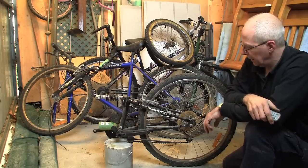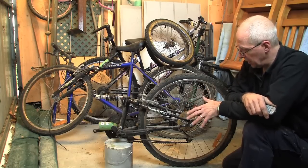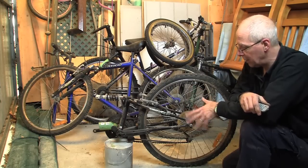The first step will be to cut the parts off the donor bikes. I will be using the rear section of this mountain bike, including the suspension, to form the base of my trike. I have cut the front half of the bike off, so I am now only left with the rear section, the swing arm and the shock absorber. The pedals and the chain will all go.